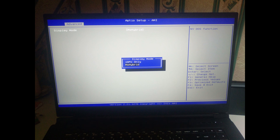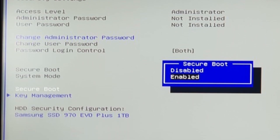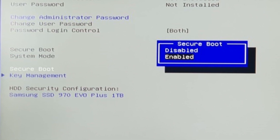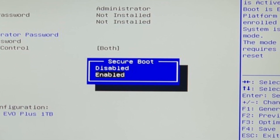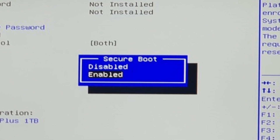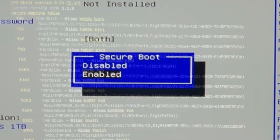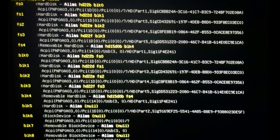I won't cover the precise instructions the manufacturer already provides together with the BIOS file, but there is something more to add which those instructions lacked. After you prepare your USB stick with the updated files, you first need to enter the actual BIOS security tab and check that secure boot is set to disabled. This is an extra security that allows only Windows and other certified OS to run. The USB pen is not, so you need to temporarily disable it, else it won't run when invoked with the F7 button upon reboot. When you finally do, you'll be presented with this legacy EFI shell.